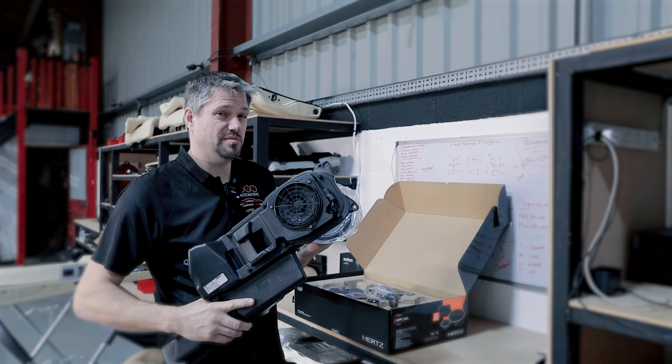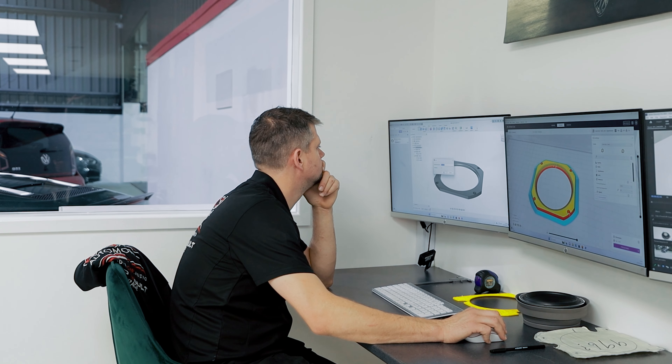I've got a couple of bits here. I'll explain at the computer. With this Porsche it's a bit different to normal speaker adapters because the original speaker is a small 4-inch speaker inside its own housing, almost like a subwoofer box, designed to fit in the door aperture. Once that's taken out there's a huge gap — no speaker is going to fit straight away. So I've made a template, scanned it in, and I'll build up a 3D model from this base plate to house the speaker.